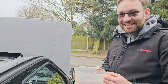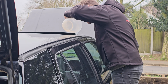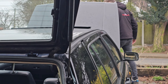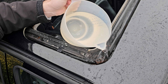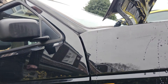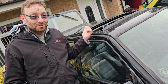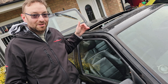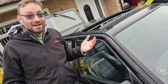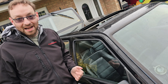I wonder why the car is covered in scratches — because those little blighters with their tiny claws trying to get grip. So that is how you check the sunroof water drains to make sure they are clear. You can also do that test with the sunroof closed because the seal around the edge isn't watertight — it is designed to let water through to go down those gullies as I showed earlier. But it is obviously easier to see where the water's going if it's open. I hope that helps. Now let's find the actual source of the leak.